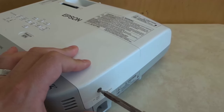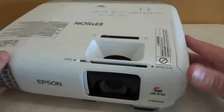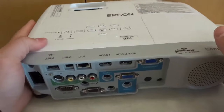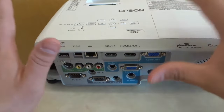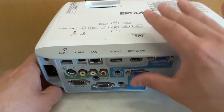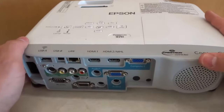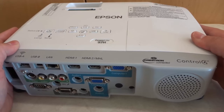So I'm just using the screwdriver to tighten up this screw until it is nice and secure. And that is basically it. In this video I have shown you the process for changing or replacing the lamp on this Epson PowerLite 97H projector. It is a very simple process. It is very important to make sure you have unplugged the projector and that it has been powered off for at least one hour at the minimum, to make sure the lamp is nice and cool, because it does get quite hot when the projector is being used. Make sure you let the projector cool off — unplug it and power it off for at least an hour before you attempt this. If you liked the video be sure to give it a thumbs up, let me know what you think in the comments, and subscribe for more great videos. Thanks for watching.